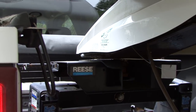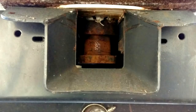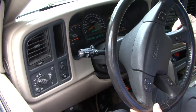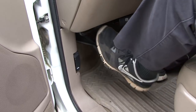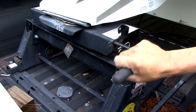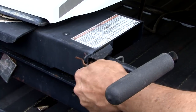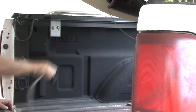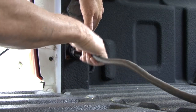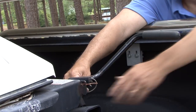It may be necessary for the assistant to make minor adjustments to the height of the kingpin. Back up until the kingpin fully engages the coupler jaws. Put the truck in park and set the emergency brake. Secure the locking bar and the safety latch. Connect the 12-volt trailer light cord to the receptacle on the tow vehicle. Connect the breakaway switch lanyard to a permanent fixture on the tow vehicle.